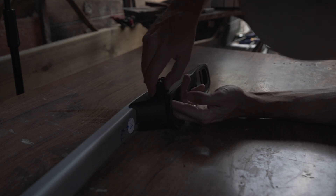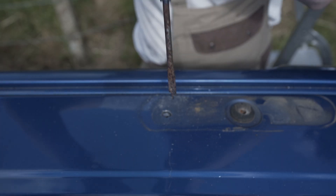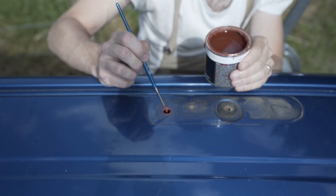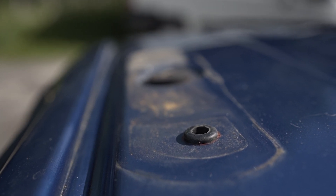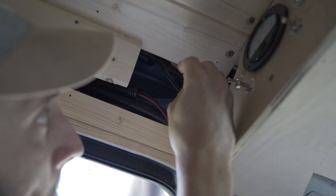If the weather's holding up, you can go ahead and drill a hole into the roof that's large enough to fit two solar panel cables through. You can then go ahead and apply some red oxide around this newly cut edge to prevent it from rusting later down the line. I also installed a rubber grommet to prevent the cables from chafing and later grounding out.